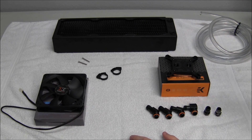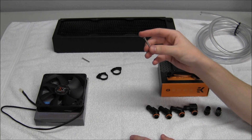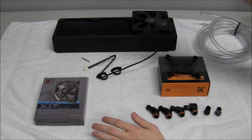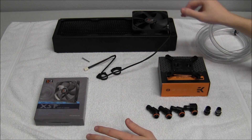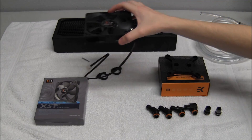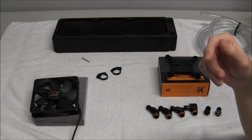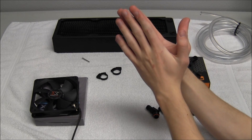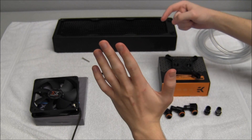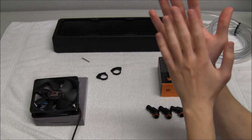A common question is how to mount fans onto the radiator. They come with special longer screws — you put the fan on the radiator and insert the screw into the hole, tying it down through the top of the fan. If you're mounting fans between a case and the radiator, you put the fans on the inside of the case, then sandwich the radiator against them with the screws going through the back of the case, pinching the case and fans between the screw and the radiator.